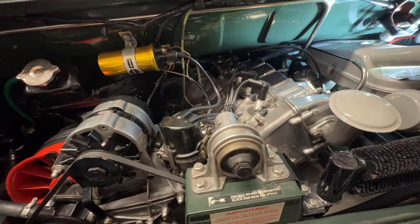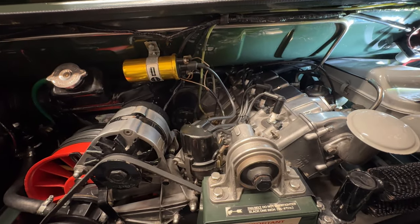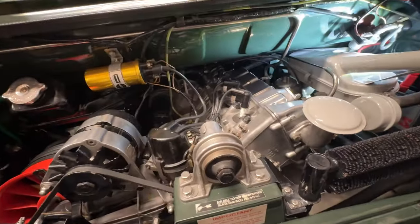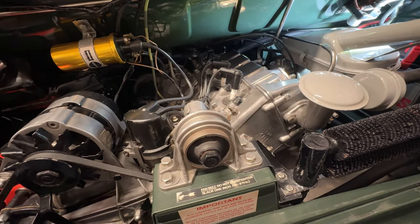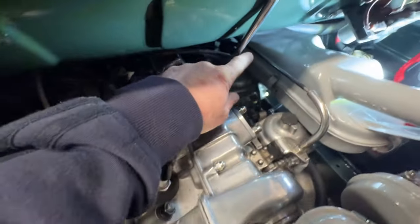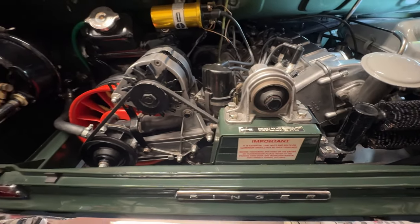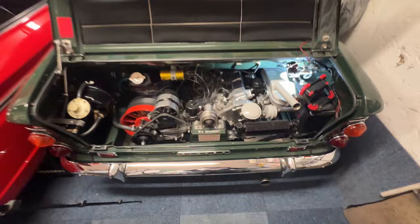This is the engine mounting which holds the back end up. It's very easy to take an engine out — you've got about six spanners needed: nine-sixteenths around the back nuts, three-quarter here, 13mm or half-inch in the corners, two down the side. The back panel comes off, take your hoses and wires off — accelerator and choke cable, vacuum hose — and it's done. Just jack the car up, get a jack underneath to support the gearbox, undo your bolts, pull the bumper and pull it out. Quite a simple car to work on.